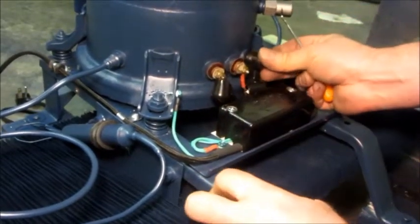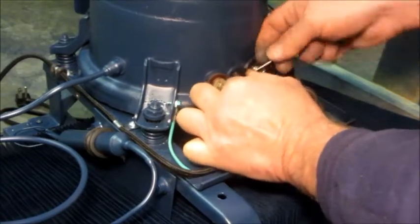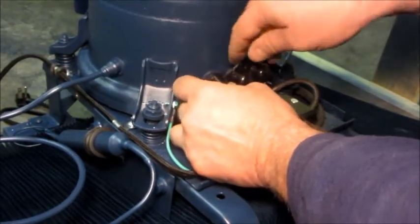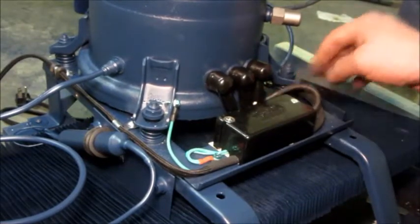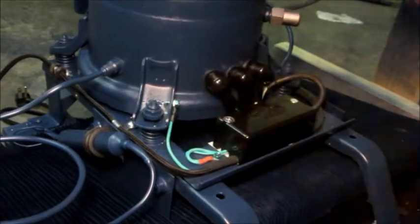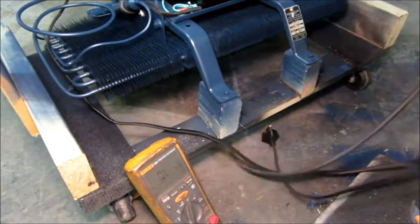By a lot of people's standards that's not repairable. These boots are nice because they go all the way back over the washer — there are no exposed live contacts — but they're a little more difficult to install than the original style ones that were much smaller. In my opinion it's worth it because it keeps someone from touching it and getting shocked. The wiring is done on the condensing unit — it is ready to go back in the cabinet when the cabinet returns from paint.